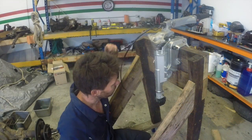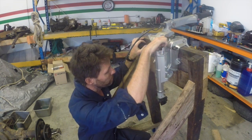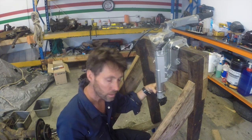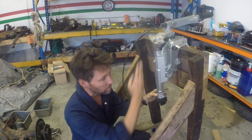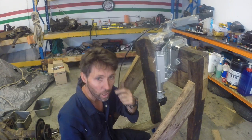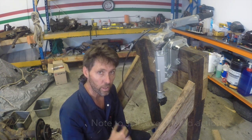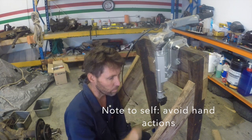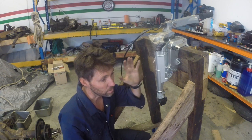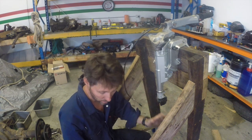Next thing is to separate this pivot - the steering mechanism from the bracket. That involves undoing two bolts here, dropping the bottom off, which allows us to slide the steering tube up. That'll have a couple of bushings on it. So if you've got really stiff steering and it's not your throttle, this is where your problem lies. Unfortunately you can see how much we've had to take apart to get to this, so it's not a small job - though it's a trivial thing to fix when you actually get to it.